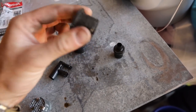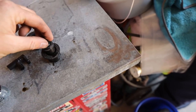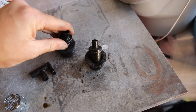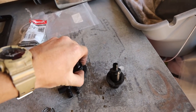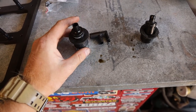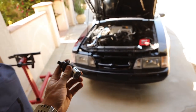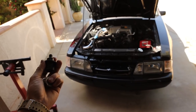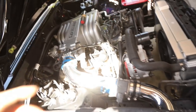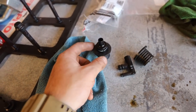This is an absolute must-have — if your car does not have this piece, it will burn oil exactly like mine does. I did not have one; I don't know why it was never in the car when I bought it. The other issue is this rubber grommet — the old one is plastic, doesn't absorb or seal anything. The new one when I pop it in doesn't come back out, seals very well. So the screen goes in first to prevent oil from getting up into the check valve, then the grommet and check valve go back in. This was the reason the car burned oil.